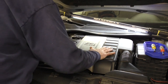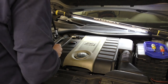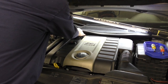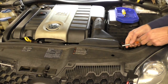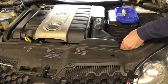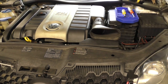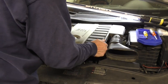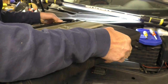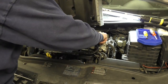Let's go in after that thing. First things first, this whole cover has to come off. There would normally be a clip here, but it's been broken off because it's come off so many times. Pop these little clips loose, and then over here on the air snorkel there's a 7mm screw that holds this on. This should pull off the little rubber grommets that hold it on. Some may be missing, broken, or stuck on the engine.